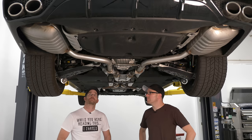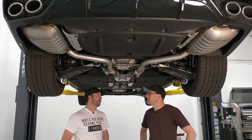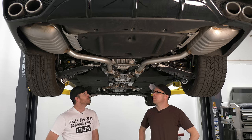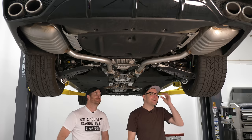In the back, there's a very special feature that's going to make driving this extremely exciting — you have mismatched rear tires. It probably had a blowout and that's all they had in stock to fit this size. They are 275s in the rear with a 400 treadwear rating — 275/30 or 275/35 or something similar. These tires are barely average at keeping the power down, and in the wet they're not great. I think this car would be amazing with a swap to some real tires.